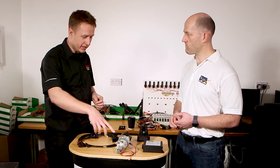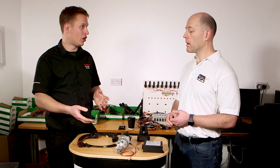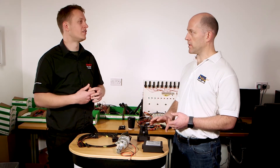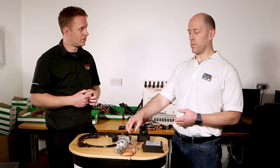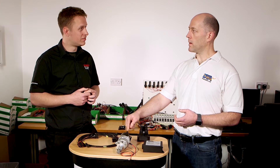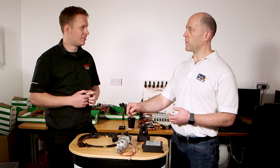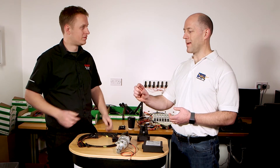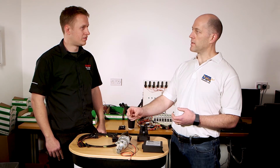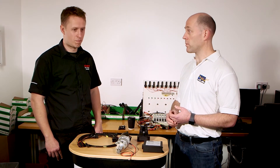So inside the distributor, is the rotor arm doing the same job as the crank position sensor on the regular kit? No, you still need the crank position sensor with the distributor setup. The ECU fires the coil, and whichever spark plug the rotor is currently pointing at, that one will fire — that's how the timing works on a distributor. It does mean that your timing advance and retard is restricted by the mechanical connections in the distributor, but for most ECUs and most engines that's not a problem at all.